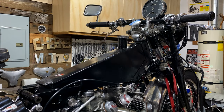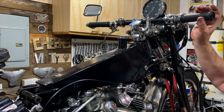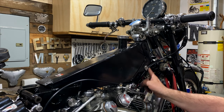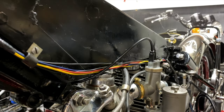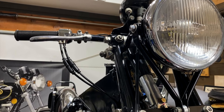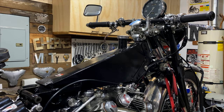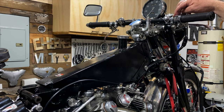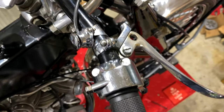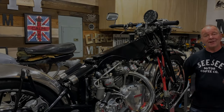Okay, that's it. Everything seems to be working just fine. Both cables are on. Carbs are bottoming out so the cable isn't too tight. We've got plenty of adjustment here. I did go underneath after all — after making a big fuss about that. I think it would be safer and easier to do that than to go round or under the headstock, so I'm pleased with that. They're both great, they look nice. I also changed these Allen bolts with some slotted screws — they're metric, this is an EMGO unit — and I got these from CBS as well. I'll put a link in the description. They look nice, they look more original.